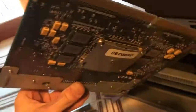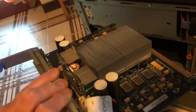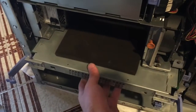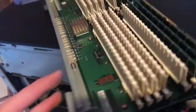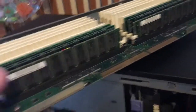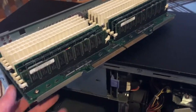The only difference between this CPU and the one used in the eServer P-Series is that this one has two megabytes of cache, while the other has four. Next we've got memory, with some foam that fortunately hasn't degraded yet. That's the memory board. There are some blanks here, probably for airflow. This is the memory controller with the same massive ceramic chip. Here you have the RAM, which I think is regular ECC DDR memory — nothing special. My machine has two gigs of it, which is more than enough for what I need.